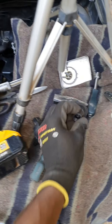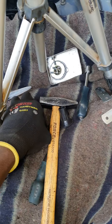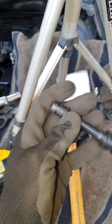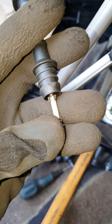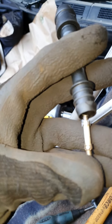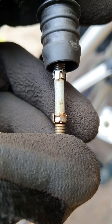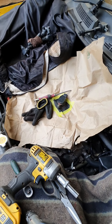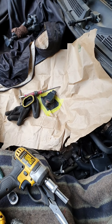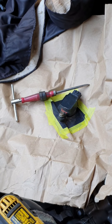That is not good, so we shall retire that one. The head is still good so I don't think I want to change that. I'll also check the stem and the resistor, which is a common failure point with these cars — the resistors get cruddy and start to go bad. We'll clean all that out; there's some rust on this one but it's not so bad. Next agenda is to simply destroy what we have not made. Probably just cut the video and get it done so there's not too much blood loss and grief.